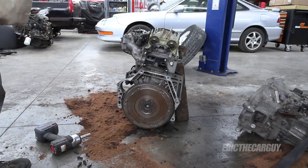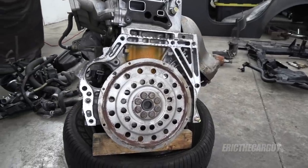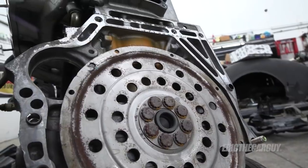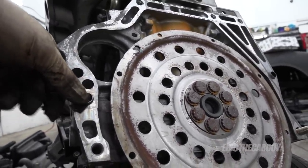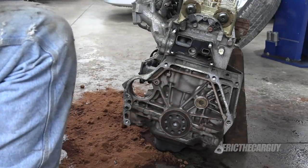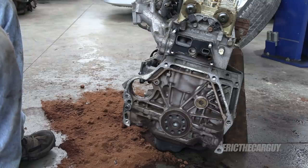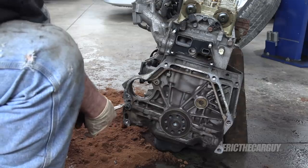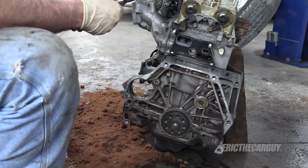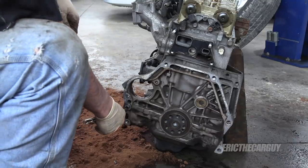For now, I'm going to get that flywheel off there, clean it up, and mount it onto the new engine. Here's a super important consideration, and that is these dowels. These don't stick out a whole lot, so I want these to come out a little more. I wonder if they're a little bit shallow because it was an automatic transmission. I'm going to get these out of here and then try to install the longer ones off the old engine. Since that side stayed in the transmission, I can leave that one alone. But I'm trying to get a comparison between this one and the automatic transmission ones because these look like they're sticking out farther. If you've learned anything from past videos — namely the transmission that I rebuilt in my son's 2005 Civic — it's that if you don't have these dowel pins, it can cause the crank to be misaligned and ruin the bearings of the transmission, in particular the input shaft bearing.